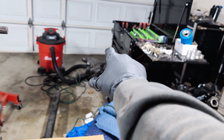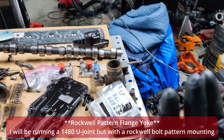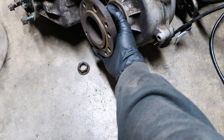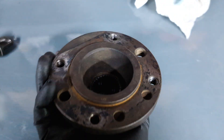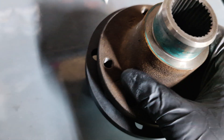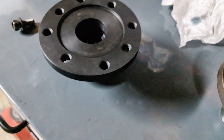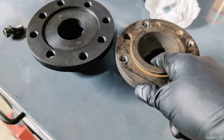Going to the front axle — the flange yoke coming off that pinion is going to be for a Rockwell size U-joint, and when I go to a 205 doubler it's going to be the same Rockwell size U-joint. So I'm switching out this flange. This is the factory flange that came on the Dodge trucks — the Dodge driveshaft bolt pattern. What I'm switching it out for is a Rockwell size pattern. When you lay them on top of each other, it's not a whole lot bigger but it is definitely bigger, especially where the bolts are that hold the driveshaft in place. I bought this flange from Northwest Fab — it's for a 205. The 205 shaft is one and three-eighths diameter, and the 241 is also one and three-eighths diameter, so it fits perfectly.